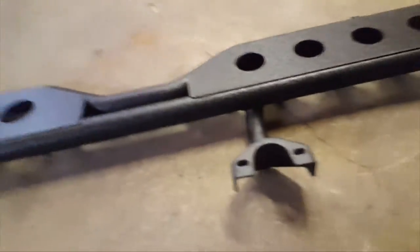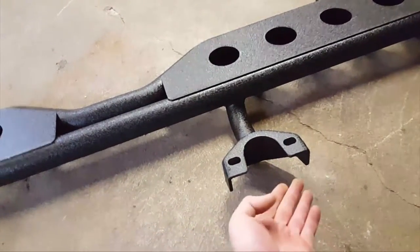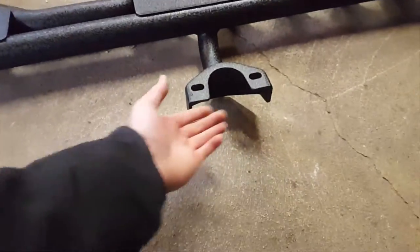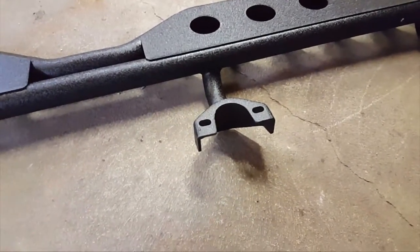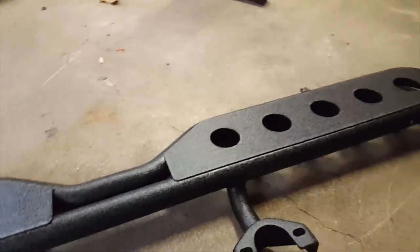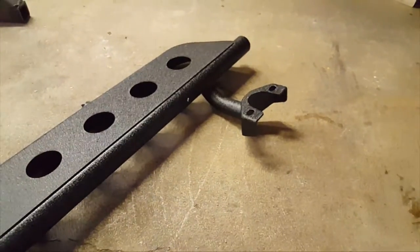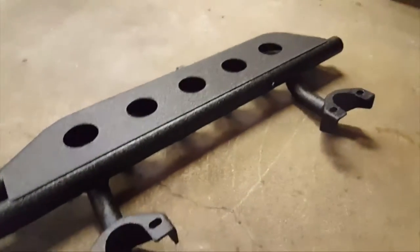The thing that makes them so easy to install is those large body mount washers — they actually slide underneath and will support the whole weight of this thing. All you've got to do is lift it up, slide it on top of the washers underneath the Jeep, and it will hold itself. Then I laid down, supported one end with my knee, pushed this side up so I could get the nut started, went to the other end, started the nuts on that end, then started the nuts in the middle.